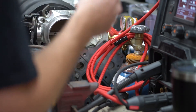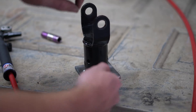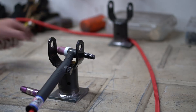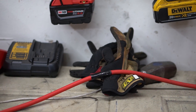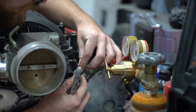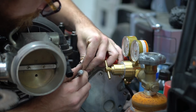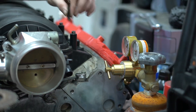I probably dipped the tungsten yesterday so I need to sharpen that. I made this practice piece to learn how to weld something around a curve because you have to start and stop a bunch and change torch angle as you go. I was just going to throw it out, but then I realized it works great as a torch holder — the torch just sits perfect in there. I also use another one to keep the hose from touching whatever I'm welding. So we're going to clock this, figure out how we want it, which should give us enough room to come off and go under to the steam port.